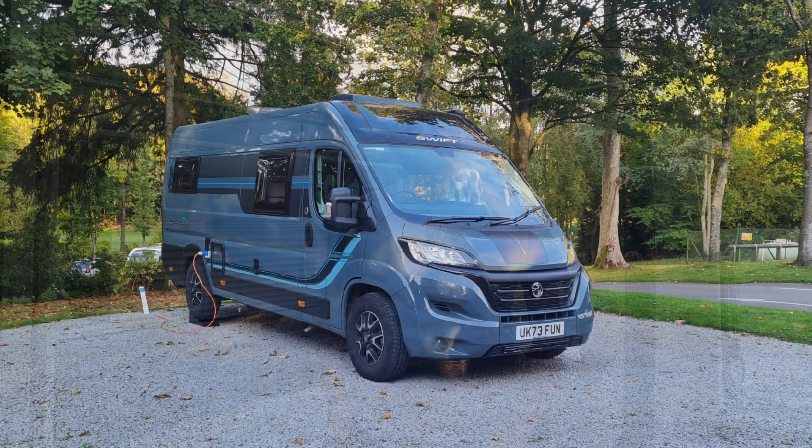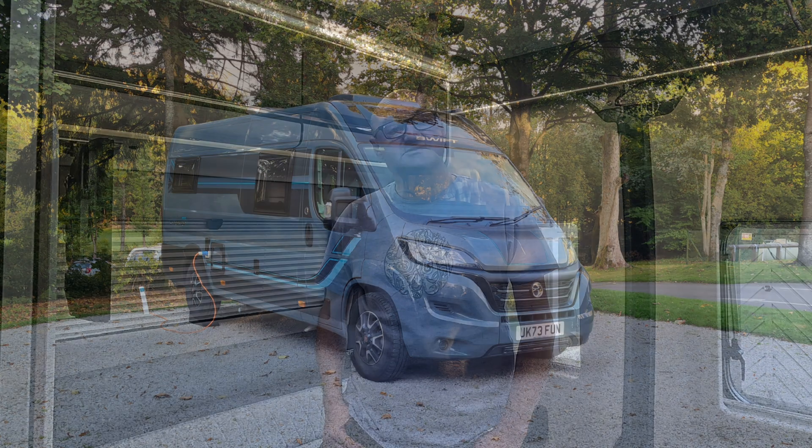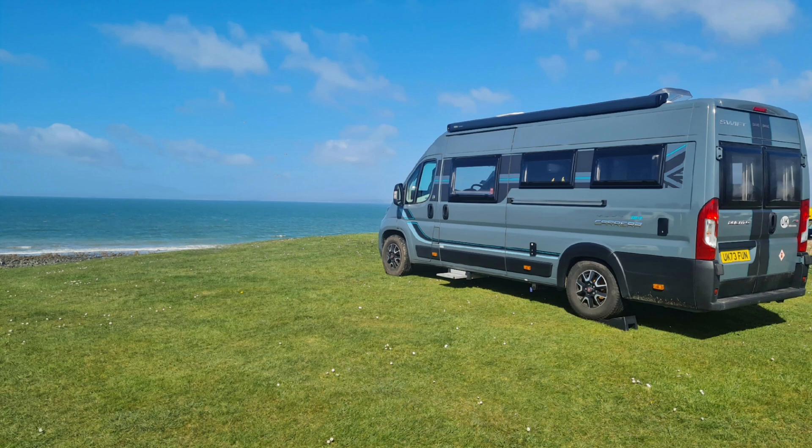That minimal approach is never going to be an issue if you primarily visit campsites where you're on hookup. Unfortunately for us, and I guess a lot of you out there, this is not what you buy a campervan or motorhome for. The moment you go off-grid camping, the factory-fitted 80 amp hour lead acid leisure battery is just not up to the job. In our experience, if it lasts a day you've done well — worst case, middle of winter, you're looking at about 12 to 15 hours at best.